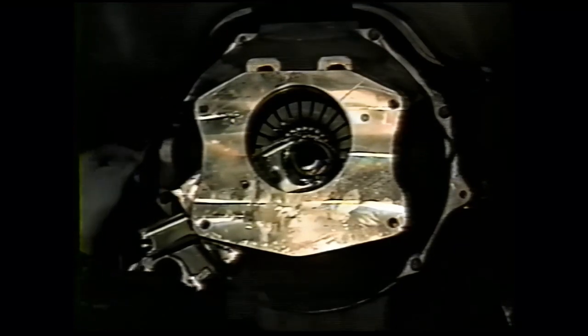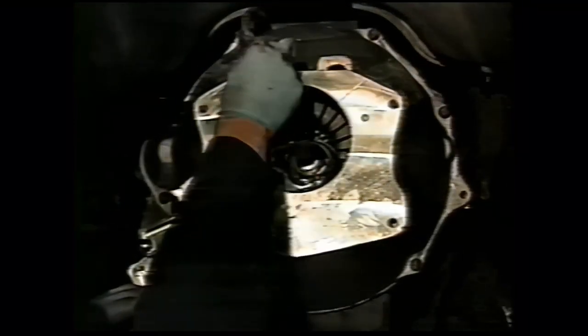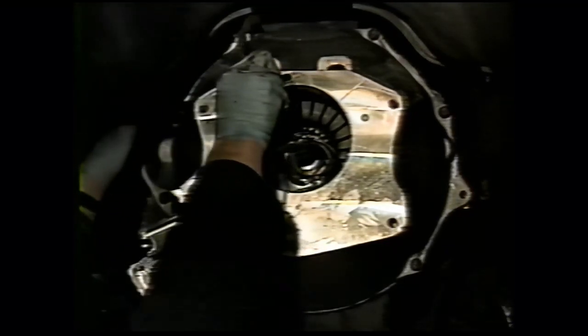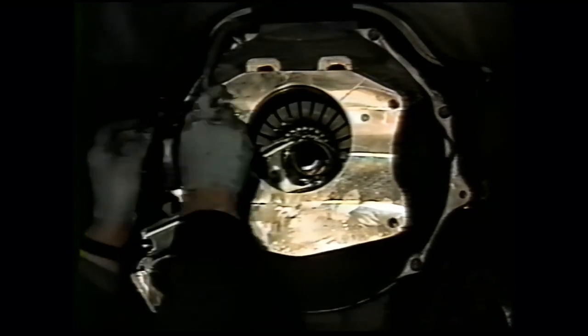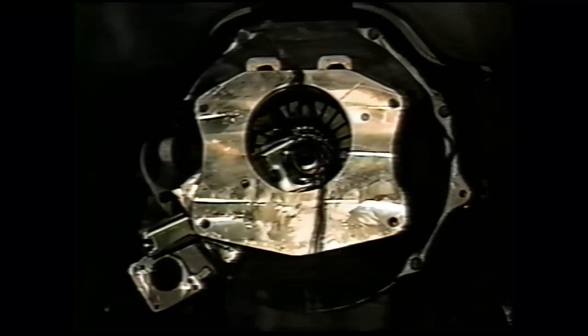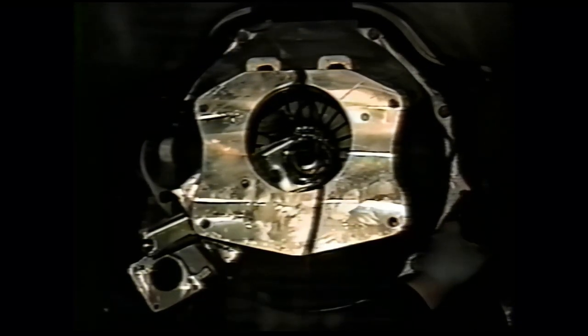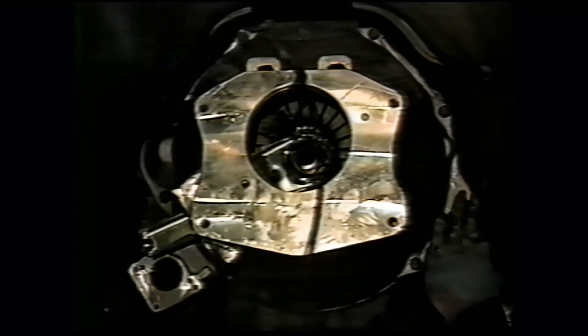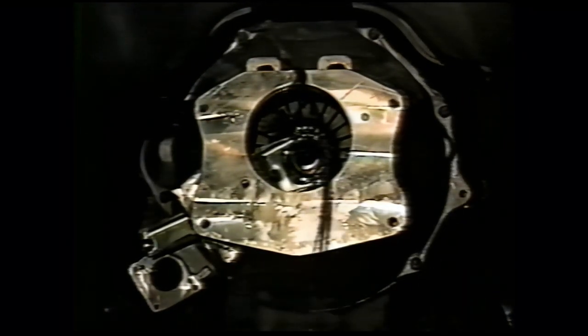We have to attach the clutch wiring harness to the appropriate hole in the bell housing. Some trucks, it's attached down here, and some at the upper left one. Put that down, then we can proceed. Hand torquing. Again, these bolts get torqued to 33 foot-pounds. The eighth bolt that goes in this area is left out until the transmission is installed and resting on the cross member. Then install the clamp bracket and the clamp to the exhaust pipe.